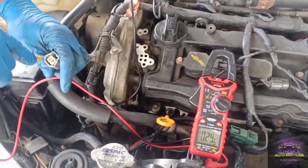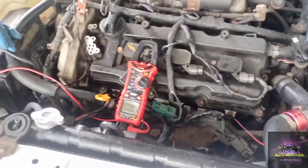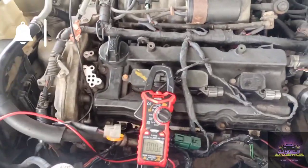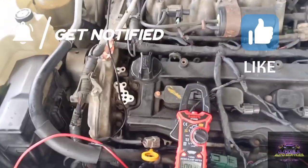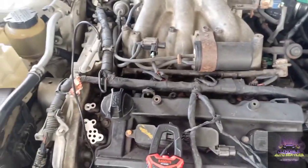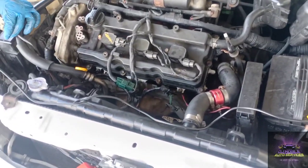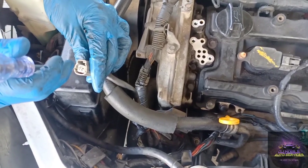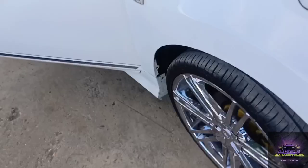Bank two pin one is reading 29 millivolts — not bad. That tells me I'm getting the same exact thing on bank one and bank two coming from the ECU. Next check: we could do a resistance check on the solenoid unit and compare it to the new one the customer is bringing in. Another test we can do — hook up to battery negative, key off. With the key off, we just lightly probe pin two and we're getting nothing, because the key is off. Now put the ignition on — see that.